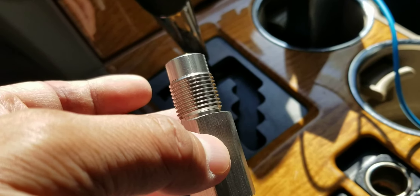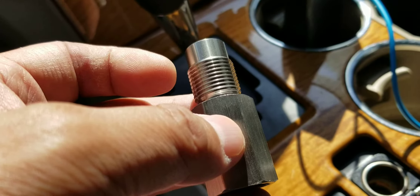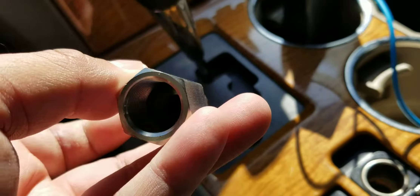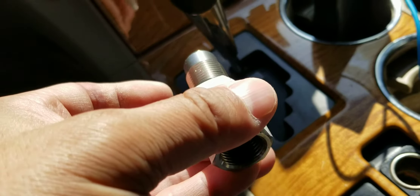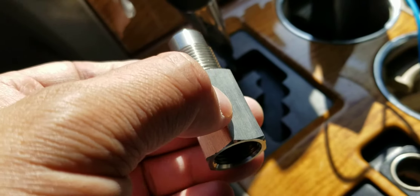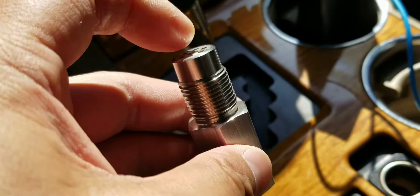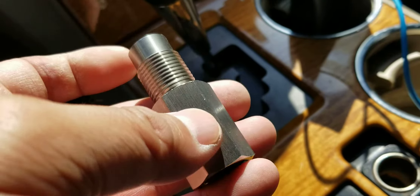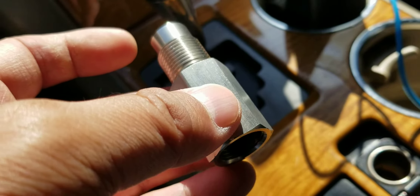Originally when that issue happened, I was using one of those spark plug extensions. It didn't really do much as far as clearing the code. I actually doubled up on it — put two of them. When I looked at the pipe, somebody had actually already doubled up, putting two spark plug extensions without any honeycomb inside, and then putting the O2 sensor on top. I tried that out for a while, but it did not do anything to fix the error code.